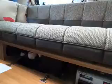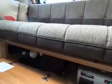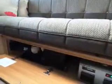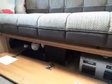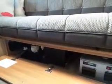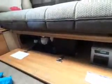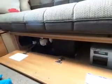Under normal circumstances, I suppose you generally just run it straight through to the taps. Do you bother with the onboard tank? Some people do, some people don't. It's totally up to you. But it's handy in the winter. If you go away in extreme weather, like some people do, you can fill that tank, then disconnect your Aquaroll outside and bring the pump in, so you've got onboard water, which is insulated because it's inside the van.